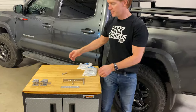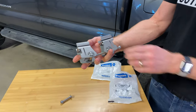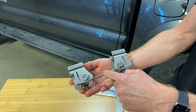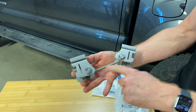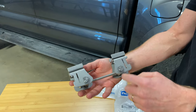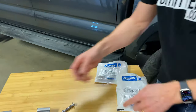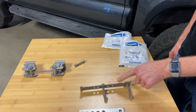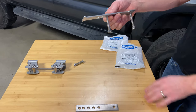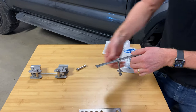The new iCamper tents include the new 2.0 mounting hardware. This mounting hardware has a limited depth between the threaded bolt and the underside of the track. So when your bars are thicker than that area, it'll be necessary to revert back to the 1.0 original mounting hardware that allows for standard carriage bolts to be used instead of this unique method of attachment.